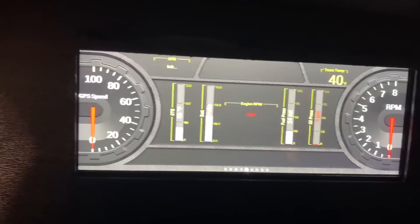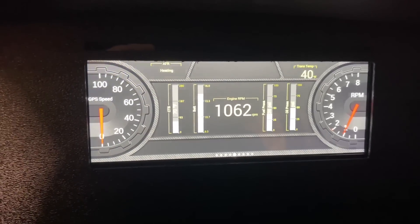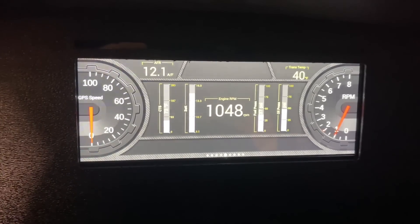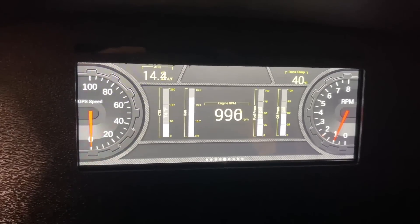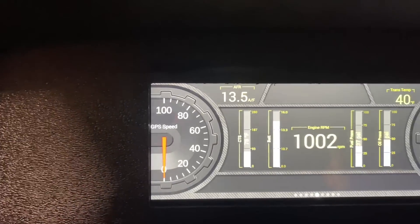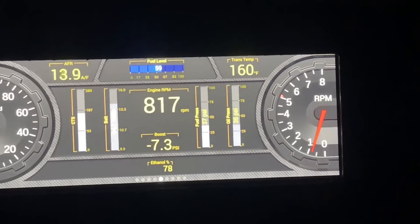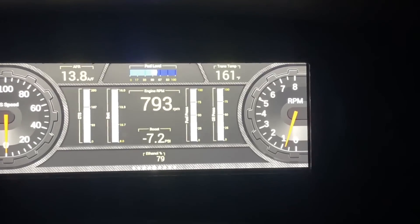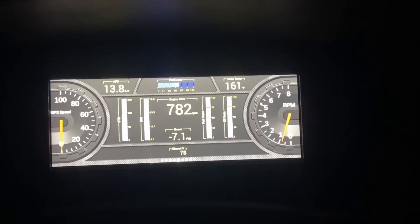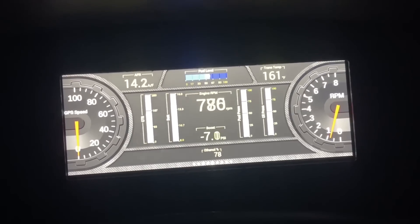Save this — there we go. 40 degrees; I'd say that's pretty accurate. Let's start it up and see what happens. Pretty cool stuff. I need to recenter it a little bit — the OCD is killing me. The trans temp gauge is working. We got the dash configured pretty good. I'm overall happy with that. I've also got my shift light LEDs set up, and warnings for trans temp, coolant temp, oil pressure, and fuel pressure. Those will light up if the temperatures go above a certain value or if the pressures drop below a certain value.